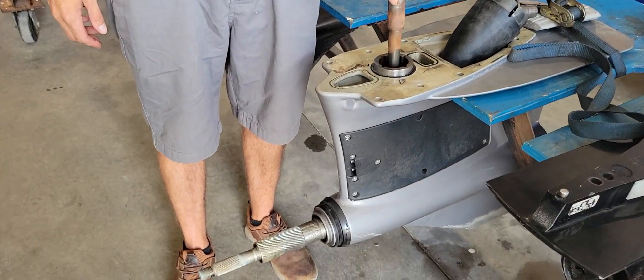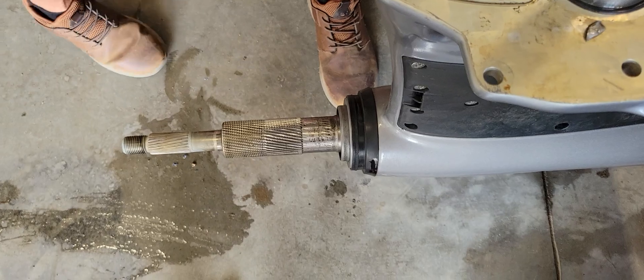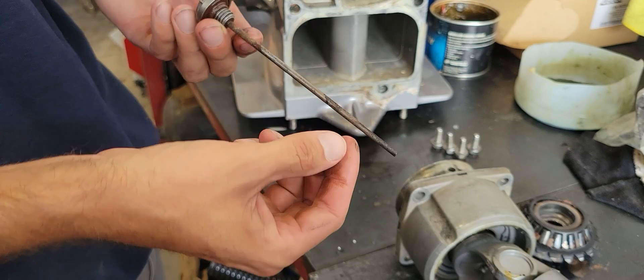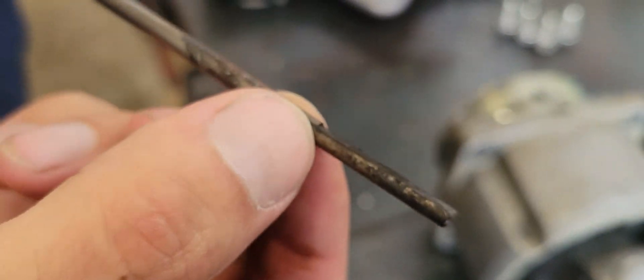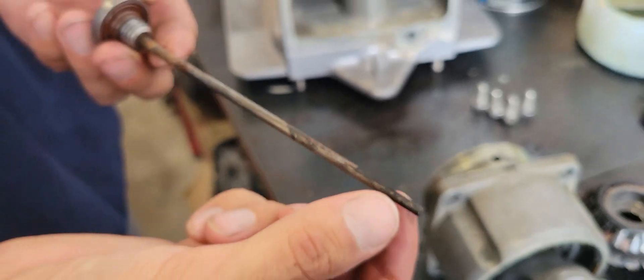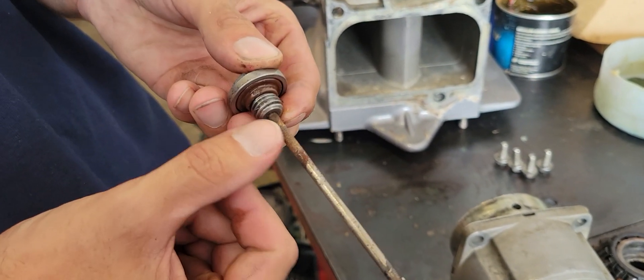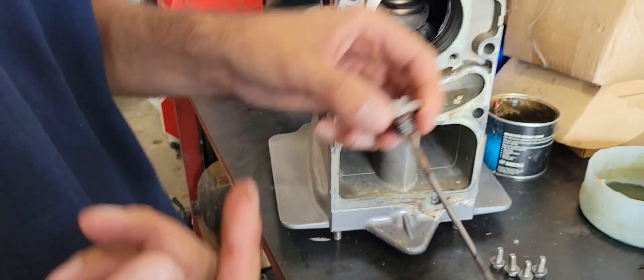This is the lower unit. It does still turn, which is pretty impressive, however the upper is done. When you pull the dipstick you can see discoloration — there's a flat section which is where you're actually measuring the oil. It should all be a clean metal color, but you can see the discoloration and even corrosion at the very top of the dipstick.